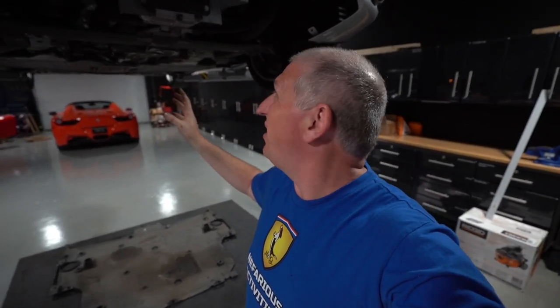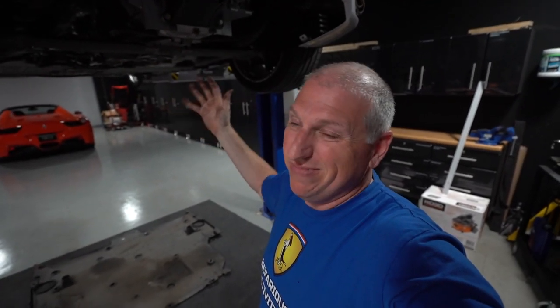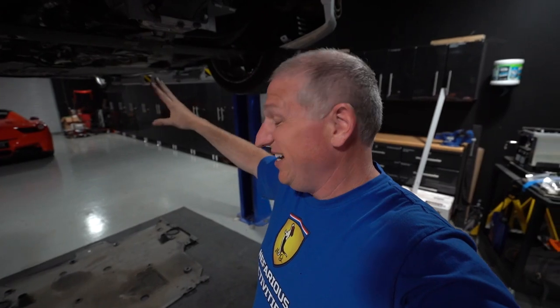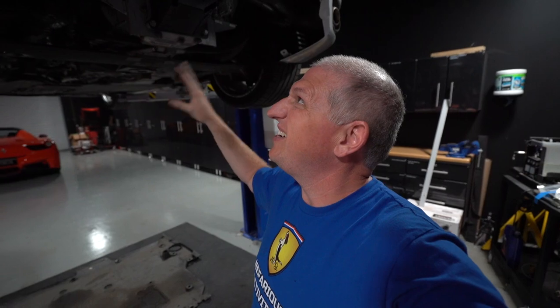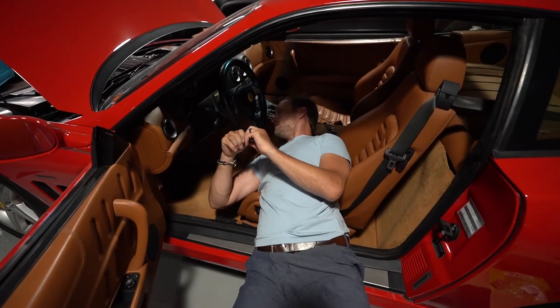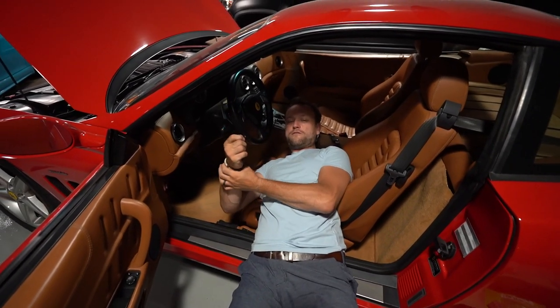There's a little bit of weeping of oil on the side of the transmission where it meets the engine — that's not unusual. A tiny bit of seepage, maybe from the AC area. Belts are fine, everything else looks fine. It's not even enough to put oil onto the pan, so it's insignificant. Valve cover gaskets are good, everything else looks good, no other leaks. This car is in pretty damn good shape — I'd say it's on the upper end of clean cars.